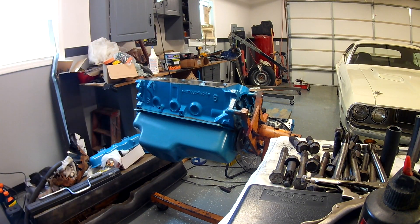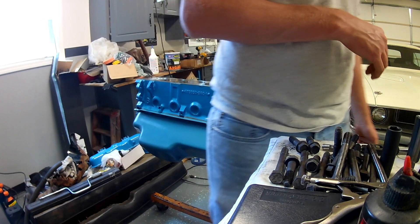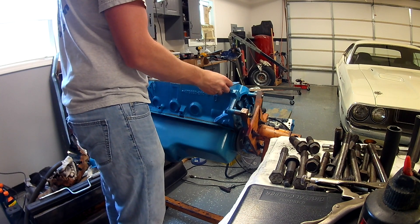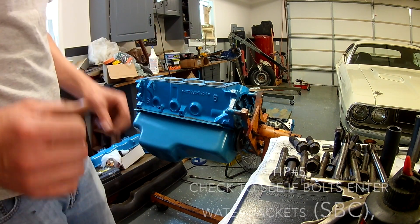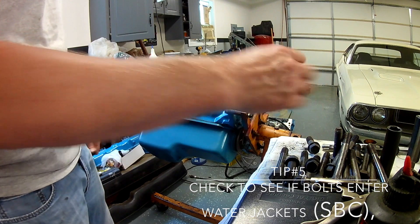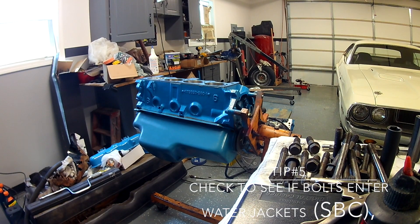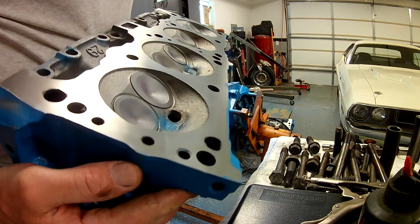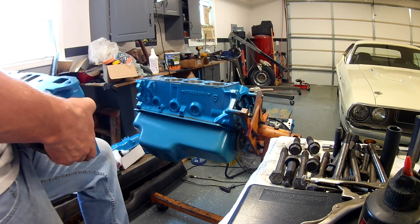Set it on the table. All right, so I know my surface is clean. I'll grab my gasket — remember these only go one way, for the valve ports to line up. You don't need to use any sealant on these. I'll get my head bolts ready, go ahead and set my head back on. You can see that bottom surface of the head — clean as a whistle. They took 15 thousandths off that and cleaned it up nicely.